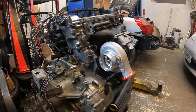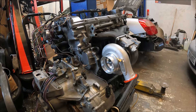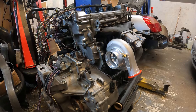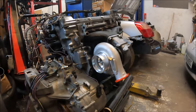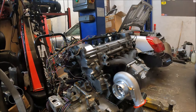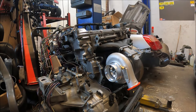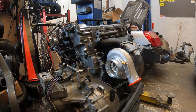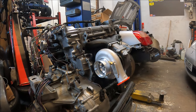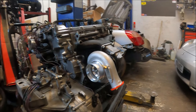The wheel is really what dictates flow. The housing is kind of there to fine-tune it. Think of it this way: when speccing a turbo, the turbine wheel is what mainly determines flow, and you use the housing to fine-tune it. You pick a turbine wheel in the correct ballpark for what you're going for — on a VR going for 500 to 550 horsepower, that would be about a 35-size turbine. Then you increase or decrease the housing to fine-tune it.